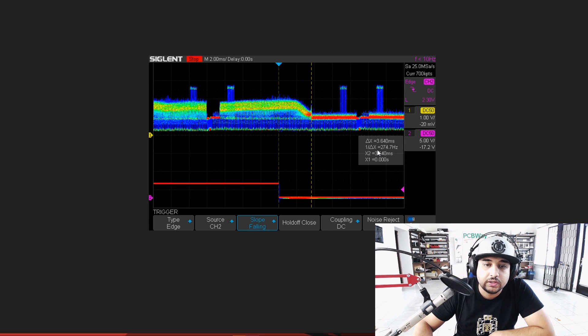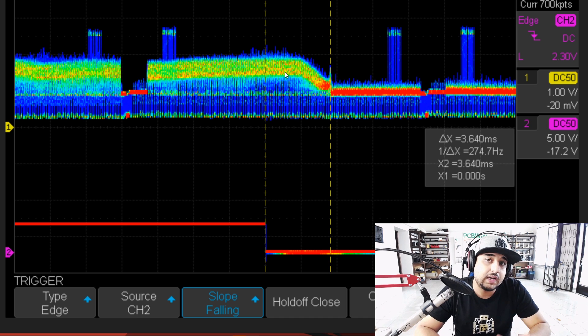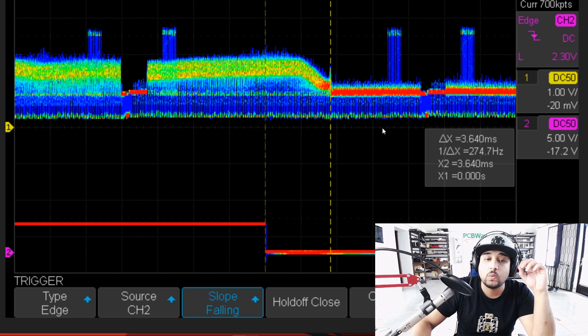Here's another one with the LED turning on, and here's another one slightly more with the LED turning off: 3.64 milliseconds. So this is the highest latency result I've gotten. I'm guessing it's using a rolling shutter because even within that whole packet frame or half a frame, it is actually registering the change, which is really great. 3.6 milliseconds — that is quite remarkable.